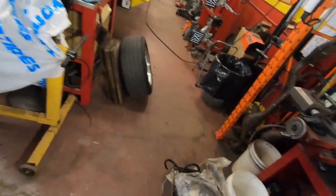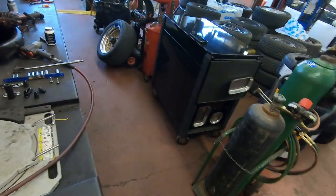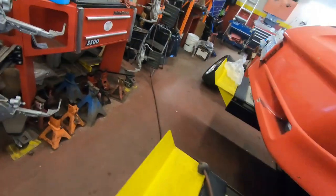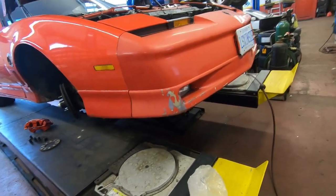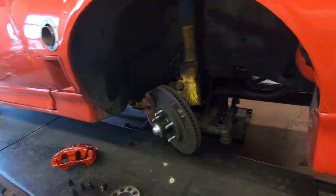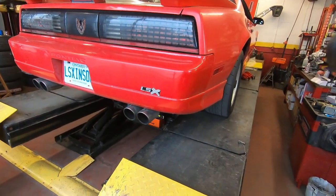Going to jump back on the Trans Am — pretty much my brakes. I didn't get to really comment too much in terms of the turbo kit, so when I get it back down after doing the calipers, I'll show you — I've really heat-soaked this thing pretty good. The clear coat has already started to discolor on it, but I'm going to heat-wrap the exhaust just because I want it to be as cool as possible under the hood, and that's the only sure way to do so. Heat-wrap it, spray-paint or heat-treat that also, and after that I've got to get some better fans — some high-flow fans — and kind of keep that thing cool. Let's finish up the calipers and I will wrap this up.